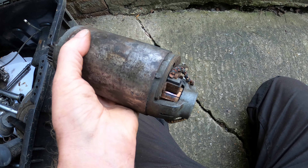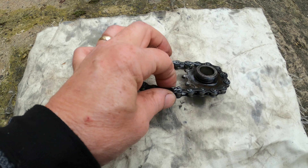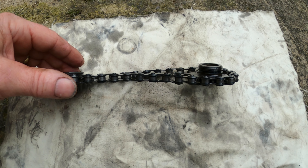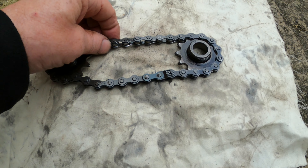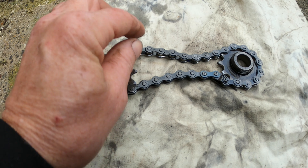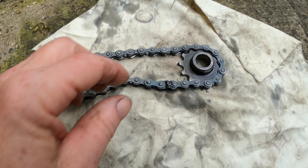There was a little bit of talk about these cheap-looking industrial type chains with a strange link and pin. It's been on there for many many thousands of miles. I was a bit concerned about it at first because it just looked really sketchy — the sort of thing you'd find on an industrial machine — but it's behaved itself. I can see on the inside of these chain links where there's been a slight bit of misalignment, as the inside of the link is polished, but the chain itself is fine.